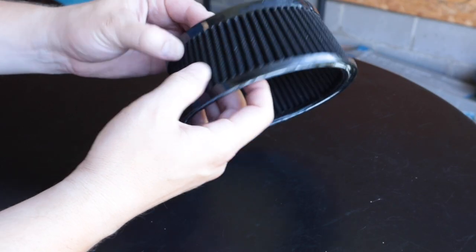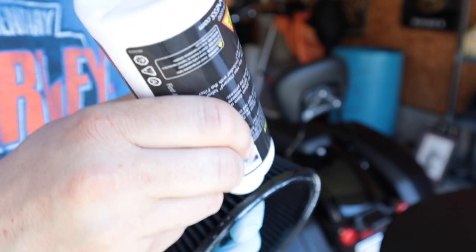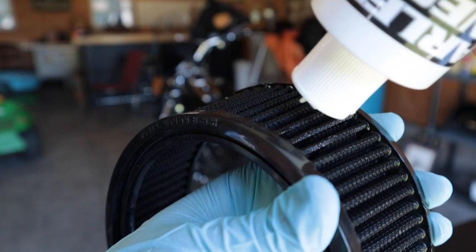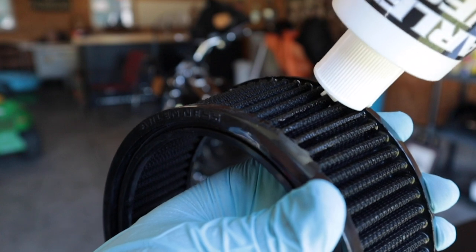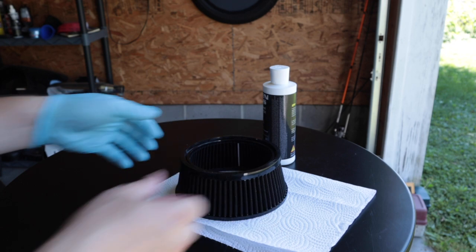You can use these things over and over again, so cleaning it more often than once a year is not a problem. Once you've got a nice dry air filter, go ahead and carefully squeeze a light application of your filter oil along the outside surface, applying sparingly with restraint. Do not over-oil — you can get drippy oil in there and that can get into your intake, and that's no bueno. Just don't be too liberal with it. It's a little harder to tell if you have good coverage because we've got a black element and I'm using a clear oil, so just make sure you go all the way around. Then let that oil seep in and wick into the cotton of the air filter for about 20 minutes.